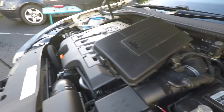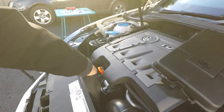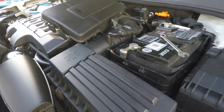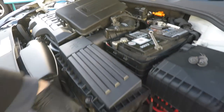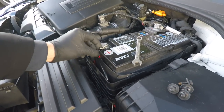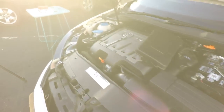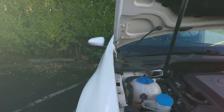So there isn't an awful lot of cable, to be honest, but if you're just careful with the way you route it, it should be fine. Just keep it on top of the radiator, get a few cable ties. If you can run it under the airbox, so much the better. You're going to save all this run around the corner here, and then I say pop it under this frame, which isn't solid, and it comes exactly where it needs to be, there. So that's one of them mounted and connected. Obviously you need to put your screws back in, but we'll come to that in a sec.